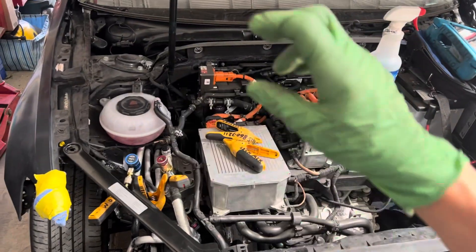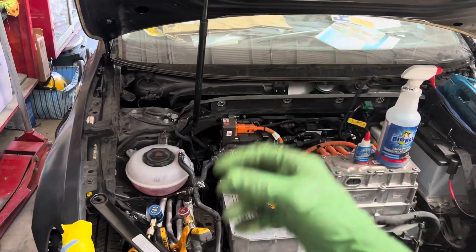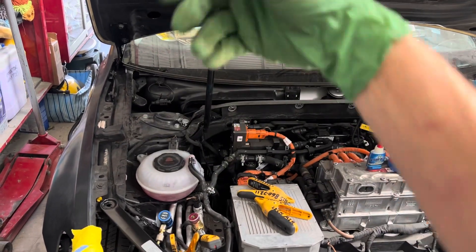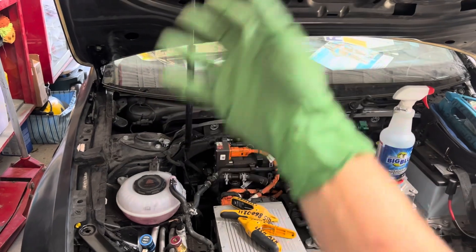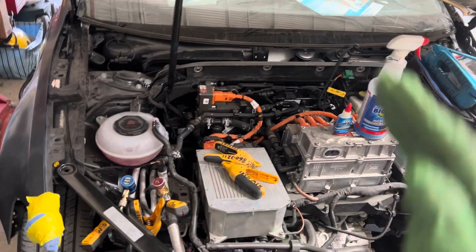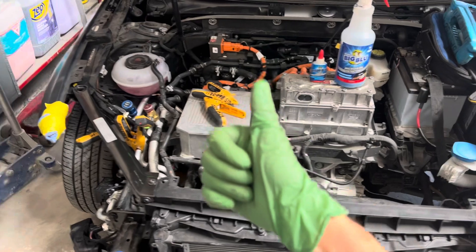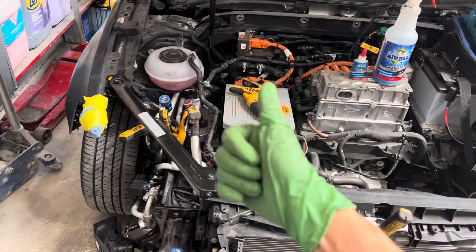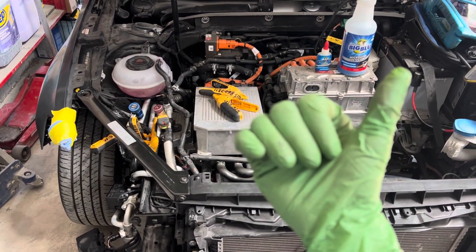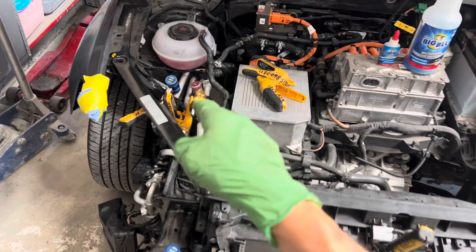The guys who don't properly turn off their hoses and leave the hose dangling and open — because they have old analog gauges where the center doesn't have a turnoff — and they go to open up the low side because they're not sure. They're seeing a negative and they open it up. They have a fully charged system. It'll suck air right into the system. We're going to make a lot of money off this from technicians who don't have experience, who don't read, who don't go to MACS and the yearly expo and seminars for training. This is going to cause problems with technicians being in a negative.